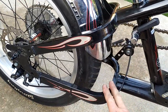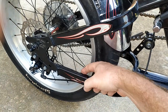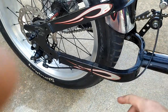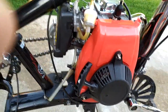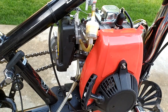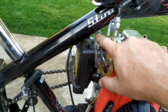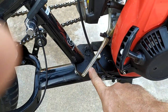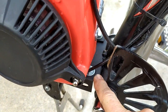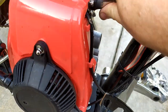The existing bike had a giant caliper brake which I removed — used an angle grinder, ground it off and painted it, then had to run a new brake line. As far as mounting the motor, everything is so tight that nothing worked by itself. Even the choke lever wouldn't fit. The rear bracket fit, but for the front bracket I had to use a piece of 3/16 steel, grind it down a bit, and mount it that way. It's strong, it's good, it's not going anywhere.